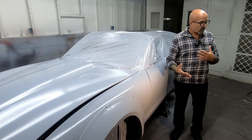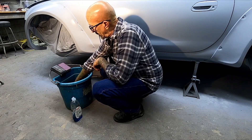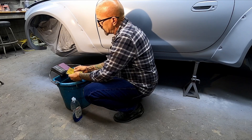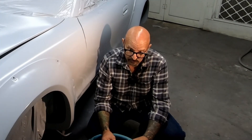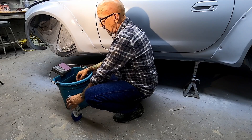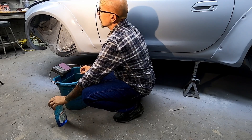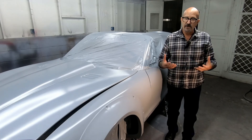Maybe you're not familiar with wet sanding, so let's talk about it. Here's how you wet sand a car — you sand it, but wet. What we do is we get a bucket of water. I've got some 600 grit paper that's been soaking in there already. If you soak it for a little while, it makes the back a little more pliable. When you buy your sandpaper, make sure it says suitable for wet or dry sanding, or that it's waterproof — you don't want something that's going to come apart in the water. We're going to put just one little drop of dishwashing detergent in the bucket.